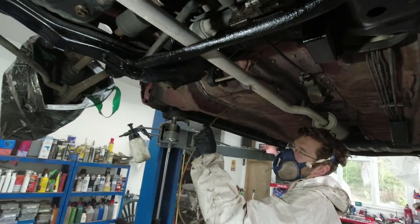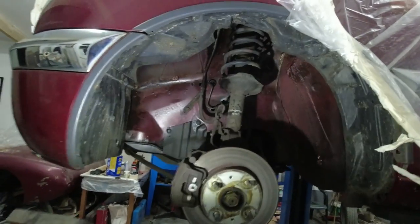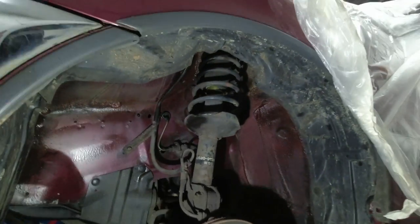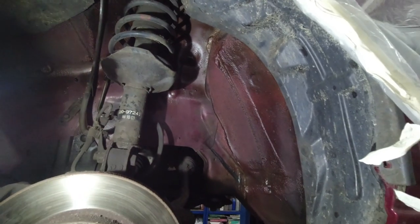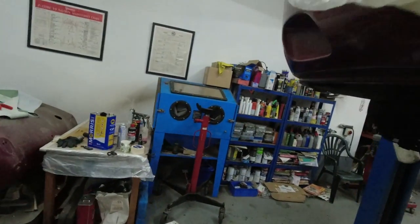Going forwards and backwards from both directions in case there's a shadow area. I think it's fair to say this job has lasted a little longer than either of us really wished for — the joys of old cars. But while I've been off having dinner and running a child to Scouts, Tim has been busy waxing away. This Anchor Wax gives us the advantage that everything is now coated in wax but we can still see the factory colour — I think that is a very fine outcome. Now we've just got the frustrating business of trying to refit bits of plastic trim; some clips are broken, some are not. For a Daihatsu job this has gone quite badly — their clips aren't usually that bad — so we may have to find some alternative ways of attaching the sill trims.